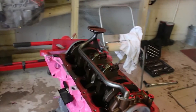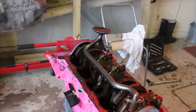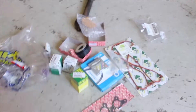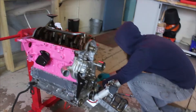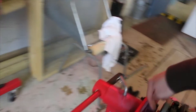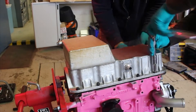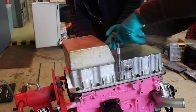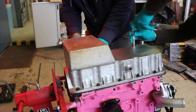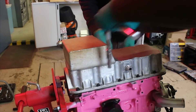We timed up the cam timing, the rocker cover can go back on once it's finished and painted. We've got all these bits — seals, gaskets, bearings, filters — so it's a nice fresh engine when it all goes back in. We cleaned up the surfaces and with four little blobs of sealer where the joins are between the oil pump housing and the tail end housing, bolted the G19 sump back on, torqued it all up, and then we're ready to go with the rest of it.